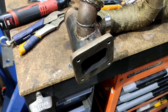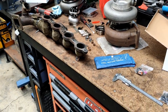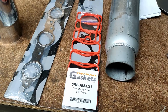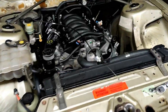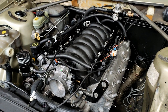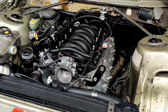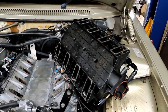It's morning — instead of starting to cut into that, I'm going to do some of the small clean jobs first, because otherwise I'll spray metal everywhere and have to clean it up. If I put these intake manifold gaskets in, I'll pull the intake manifold off, change those and the one behind the throttle body, and lift up the valley plate for a quick look inside while the intake's off. Once that's buttoned up it'll be better to move on without having to come back and re-clean. I'll get the intake off now.